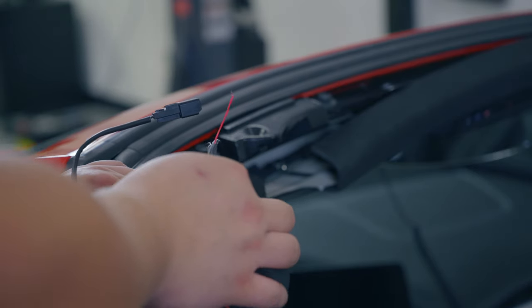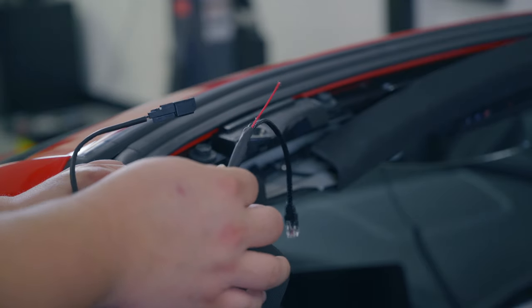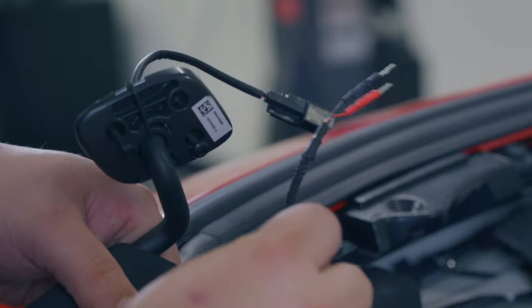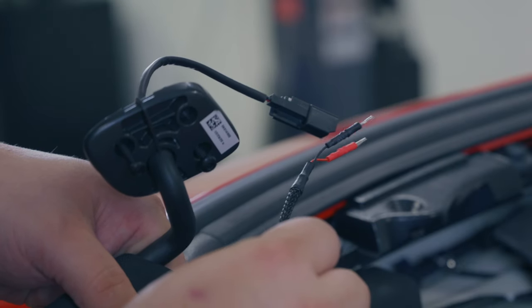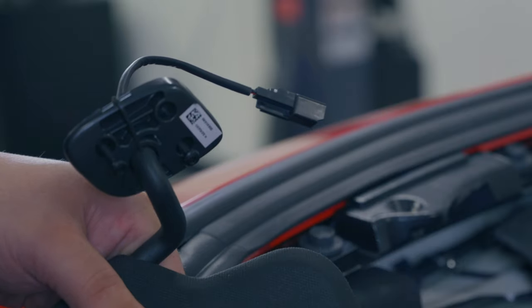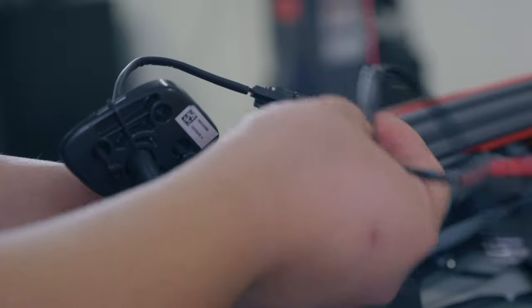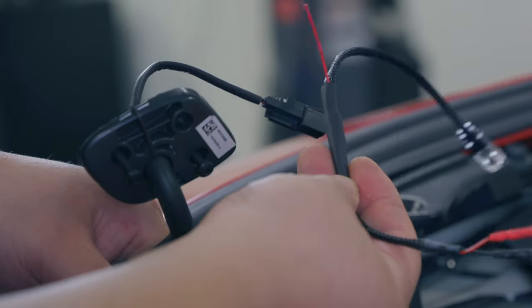The dash cam is gonna need a 12 to 5 volt step down transformer. Dash cams are usually 5 volt. The little pins back here, I shaved down just a little bit by snipping them just so they fit better, but I'll link you to where I got this, and you can just modify it really easily to add more connection just with a soldering gun and some heat shrink. It's honestly like really, really simple.